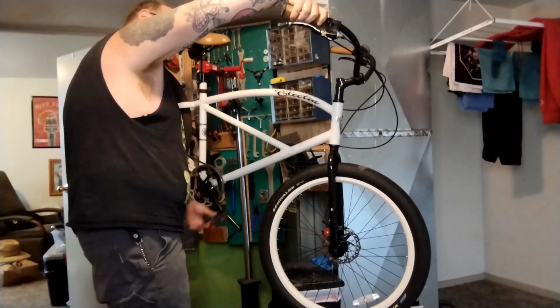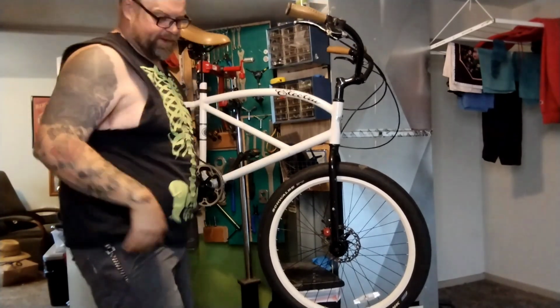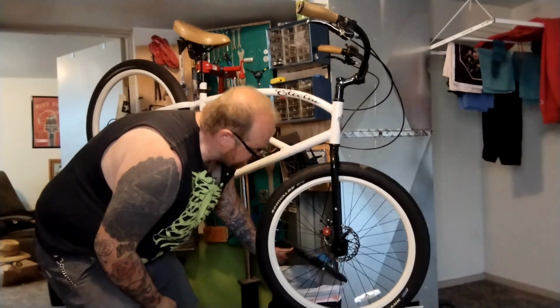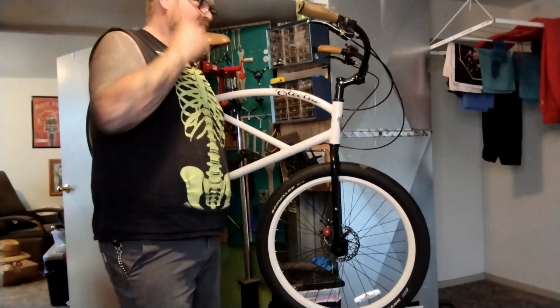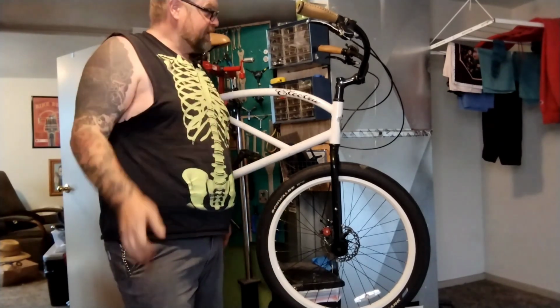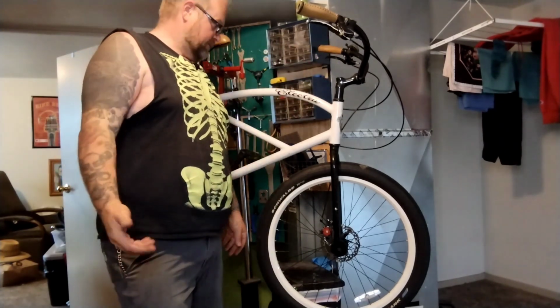Beautiful. The downside to this is that the grease will sometimes dry out again right away. So you really need to ride the bike and shift a lot and really work this new lube into the grease. Definitely had bikes where I did this, they got them working, and when they sat around for 2 or 3 weeks till they sold, they didn't work again. Had to spray them, and you gotta shift. So you find it on fronts being frozen a lot more often than rears, because people never shift the fronts.